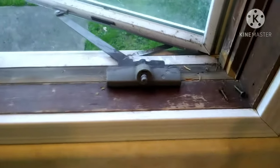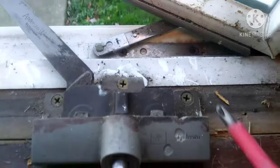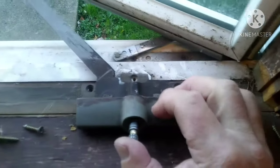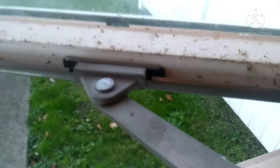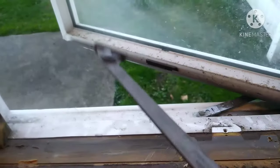Get that out of the way and then you can see the mounting screws on the back. Usually there's only three screws on the back side on these type. If you have to take that cover off, you can pop it off with a screwdriver. Just take those mounting screws out, and then when I got this thing loose I can just move it around. There's a spot on the track that will let you pull that arm off, or you can just run it clear out the end either way.